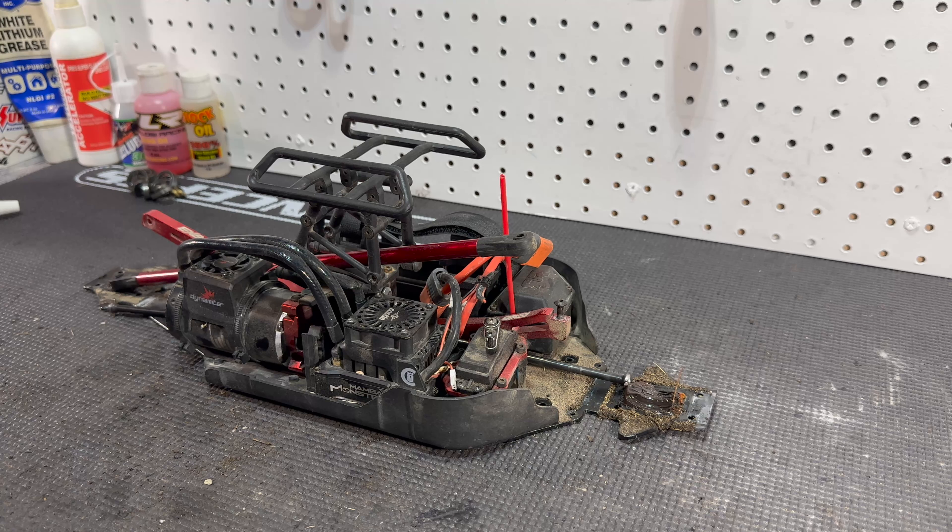The center diff is all put together with the earplug in it. Before, I could turn it by hand and it was pretty difficult, but now it takes some real force to turn it — so that's good. Now we're just waiting on the WD-40 to dry a little bit more on these plastic bits, but other than that we're ready to put the front back together. I'll flip all these over — look how wet that one still is. But overall it's going to turn out really good. I'll put you guys back on when these are all ready to reassemble.